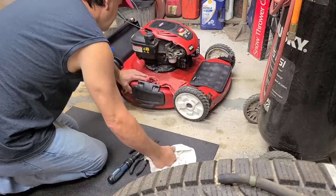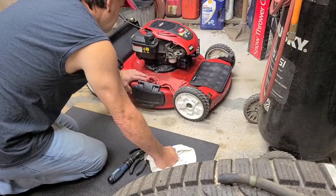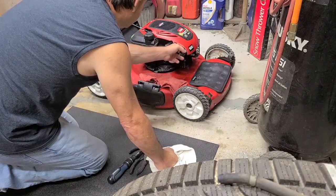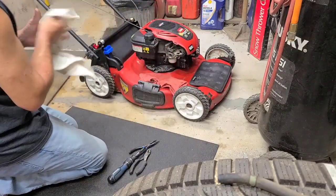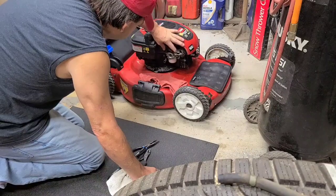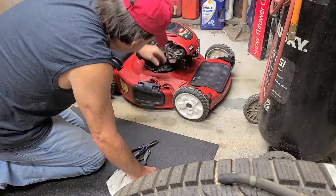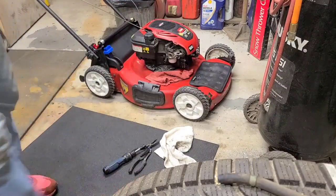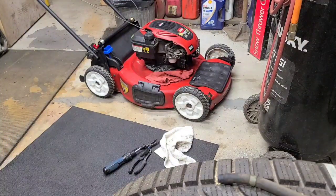Looks like he's got a governor that runs across. Got a single spring over here. What's this? More stuff for the governor. Okay, so this is probably the choke. Doesn't move that well. I think we're just gonna grab a wrench and see if I can just get the bowl off. Guessing it's gonna be metric. Grabbing a 12 and a 13, so when it's not metric, you can come back and get the half.